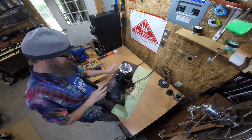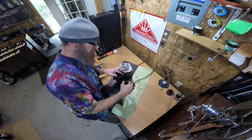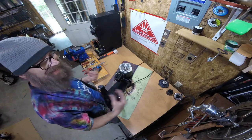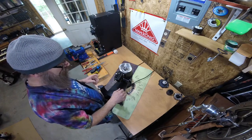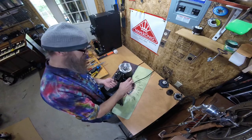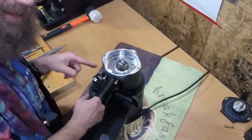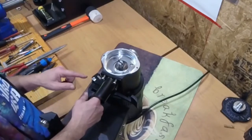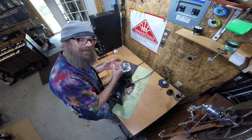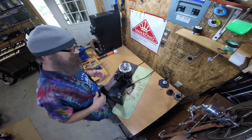For this next part I have laid the grinder on its back. You can see here is the spout — it's got these little barrels, screws, and springs. Give it a good shake; that helps break the static cling so all the grinds will fall into your bag. There is also this device — a static strip — a piece of metal that runs down usually the back left side, takes a 90-degree angle, and is held by one of the four bolts that holds the spout on against the aluminum grinding chamber. That allows it to pull the static electricity down; it doesn't get rid of it, but by pulling it down it helps pull the coffee down, which is why you have such low retention.